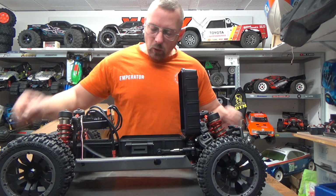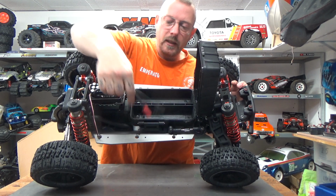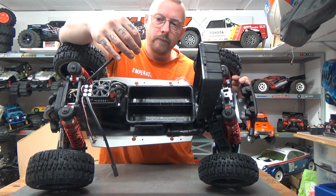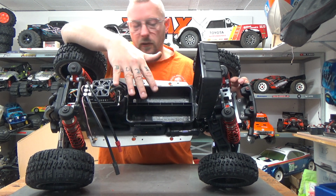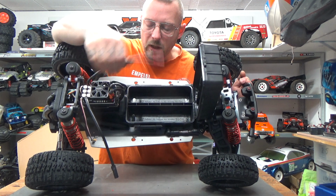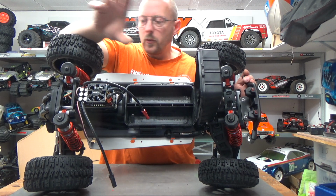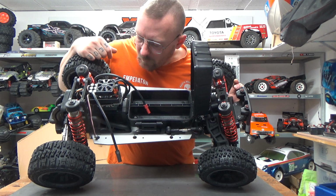So you have two holes underneath to put the wires out. Take care if you have that system here. That means on the battery you will also have to take care, by pulling it out, normally you cannot, but take care not to touch the chassis. I'm gonna put EC5 or EC8 connectors in the truck, that is clear, and I'm not gonna go underneath here to put my wires out. Maybe I'm just gonna make two holes here from the side to get the battery wires out directly.